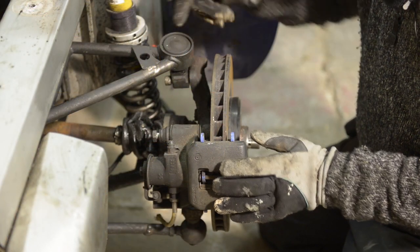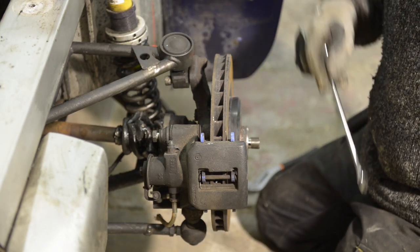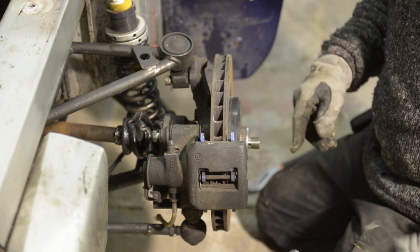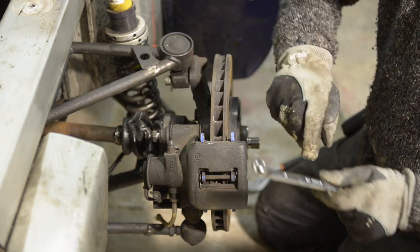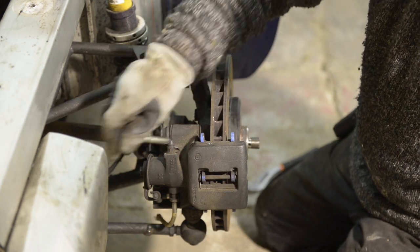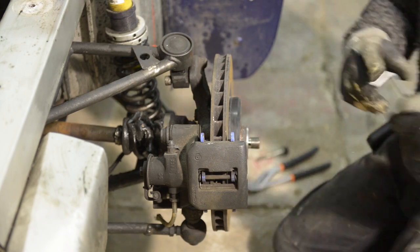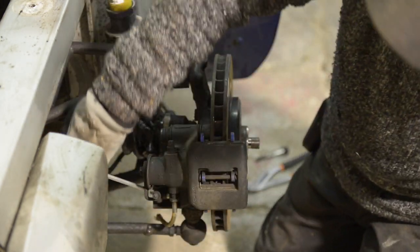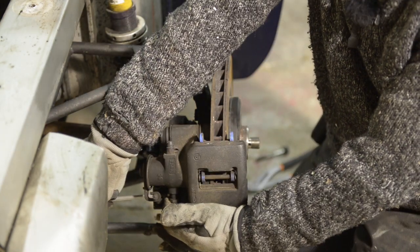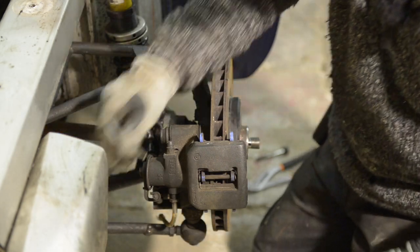Here's a close-up — as you can see the gator sitting there is completely ripped apart, and that's the driveshaft we will replace. We've already undone the front nut on the driveshaft, so now we undo this bolt on the brake, which is a 17mm, and take that off. We also have another Allen key nut right underneath there, near the brake cable. Undo this with an Allen key and the whole clamp will basically come off.